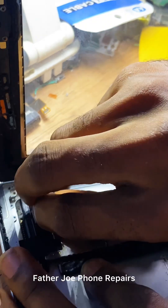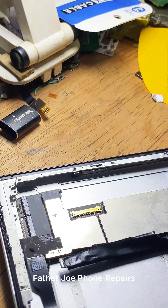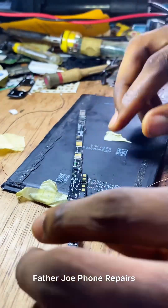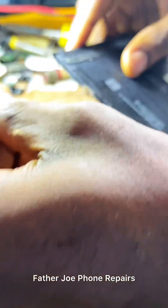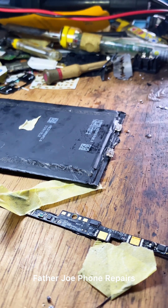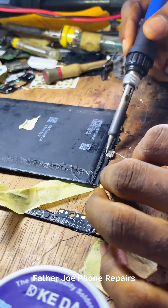You can use your hands or your picker — be very very careful. Let me keep the touchpad aside and continue my work. This is the battery BMS. Let me carefully open the battery head, pull out the tape, and remove the two wires. Bring your soldering iron so you can do the work perfectly. Make sure you turn on your soldering iron and set the temperature to high.